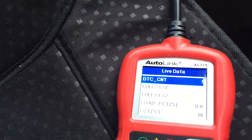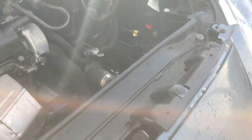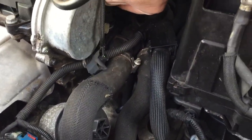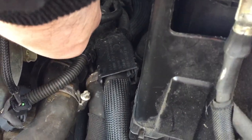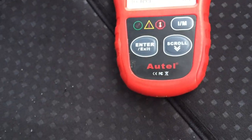Steve says to make sure that the fan's coming on, so that's what I've done. You can see on the scan tool here, with that sensor connected, we're reading 19 degrees. What I said was make sure you disconnect the right sensor, see if it generates a code, and the fan does come on. So what we'll do is disconnect that and see if it goes to minus 40. So that's the green one disconnected - we'll go back into the scan tool and I'm just doing it through normal OBD. You can see there - minus 40.